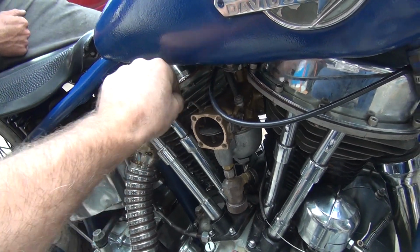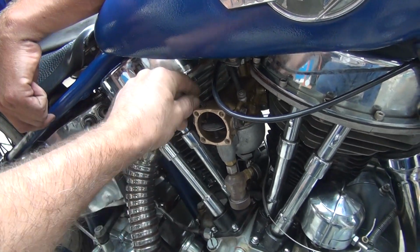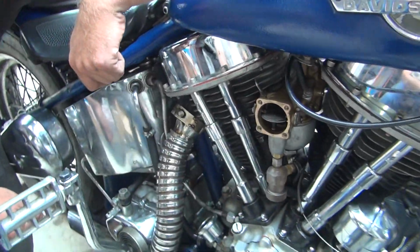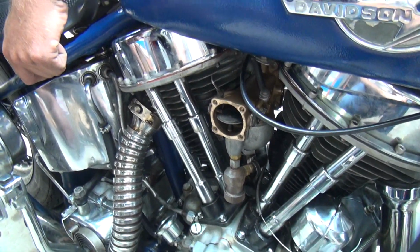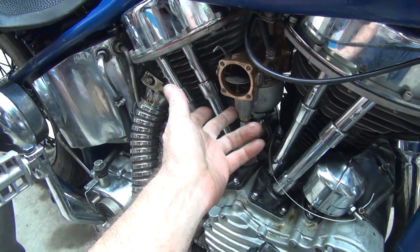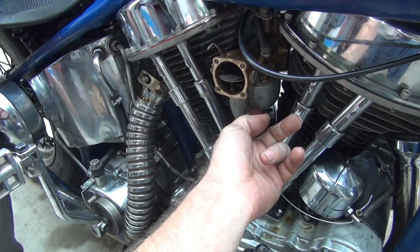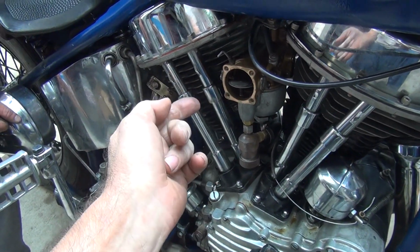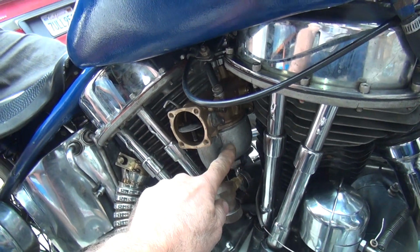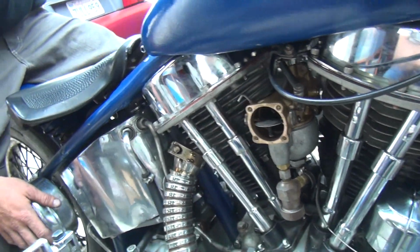Ignition off. Okay, so when you get down to close to a half a turn open, about a 3/4 turn open on the main jet, it leans out and dies. Yes. So what happens is we plugged up that main jet hole. That's right. It's feeding at the bottom of the float bowl. The main jet feeds further up. We already know the float bowl doesn't fill all the way because we did that flow test. Yes. The fuel level's only about here when it's full, even though the float level's way up here. That's right. You only get about half the float level.